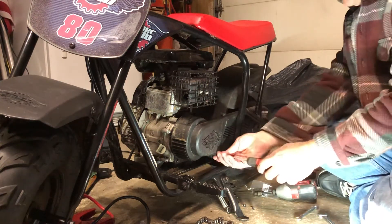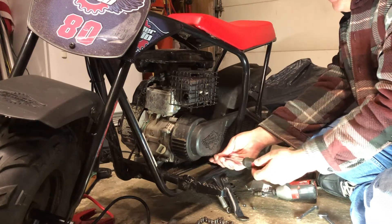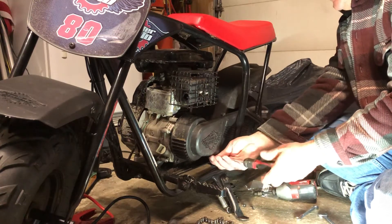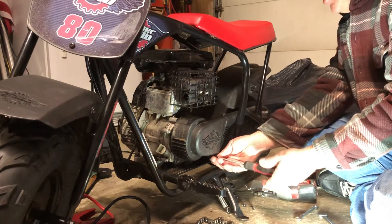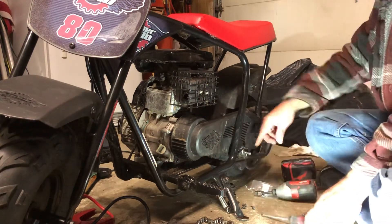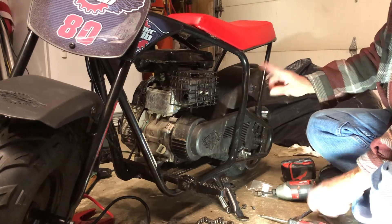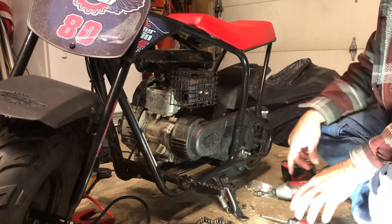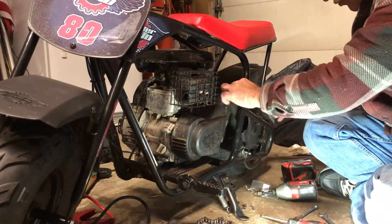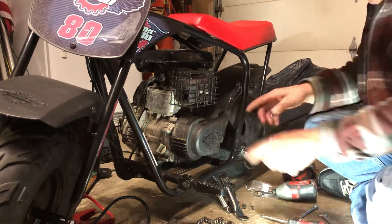There was a screw back here - Phillips. So there's three Phillips screws. And that same number 10, there's two of them on the bottom near where my hand is now, holding that into the motor. Put the three Phillips down there - they're all the same. There's also a Phillips you could loosen on the fender if you want to try to help get that out of your way. And this should come apart at that point. You could work this out of here with that piece missing, so let's get this front one off first.